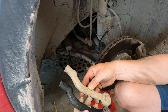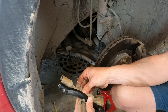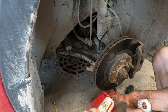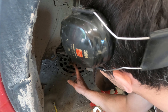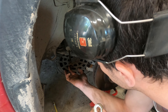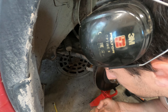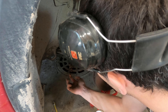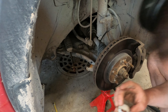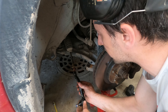I will check those too — yes, they are the same. I will put a little bit of copper paste there so that it doesn't seize. If it has to be opened again or adjusted, it will move. Those need to be adjusted when doing a wheel alignment. If they are completely seized with corrosion it's very annoying to do. That's why it's always better to put a little bit of anti-seize here. Alright, let's put it back together.